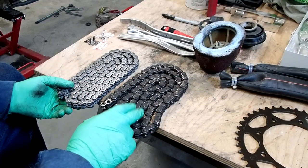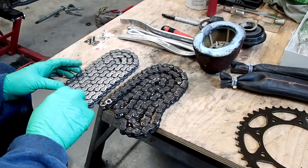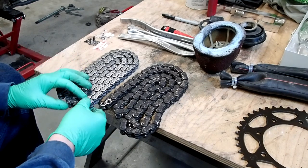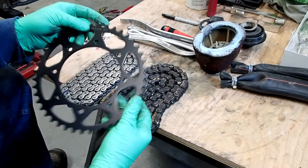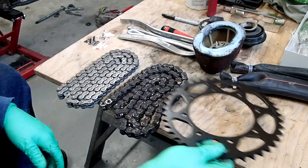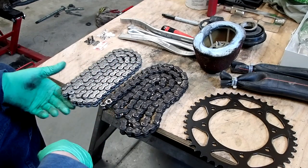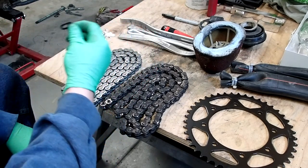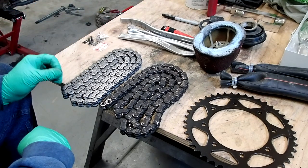New chain, old chain. I've got to hold them up and measure the lengths. I probably have to cut a couple of links off — I think I had to cut a couple of links off this one too. Just grind the head off and take the link off. New rear sprocket, going to go on the rear tire. I'm running a 16 on the front and a 43 on the back — seems to be alright. It's just an O-ring chain; the other one lasted fine so I bought another one. Got a master link for it — got to make sure that thing is facing the right way, the drive direction. Never had an issue with them. Not enough power on this bike to break anything.